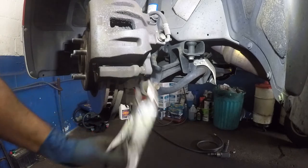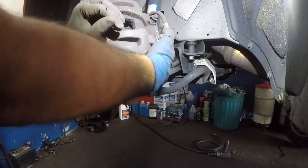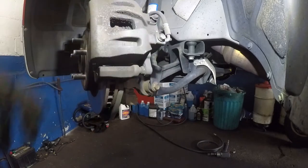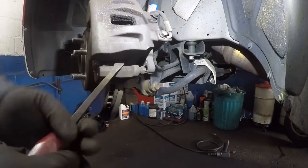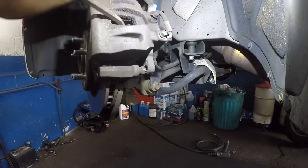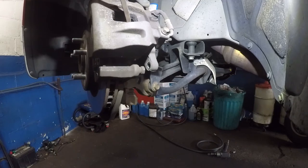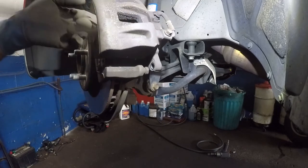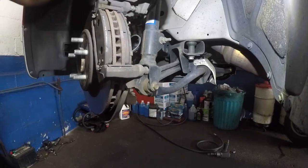That's what I hate about these Dodges, because when we get into that other bolt — number 21 — I'm going to be screaming. Take a pry bar, remove this. You can also yank the caliper. Once you make enough space, push it back a little bit and that's going to let it free-play enough for you to maneuver around.